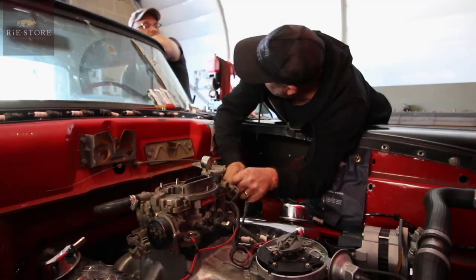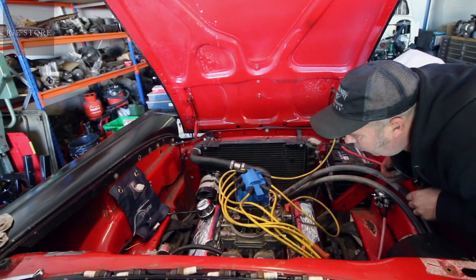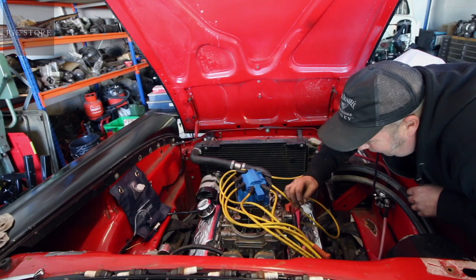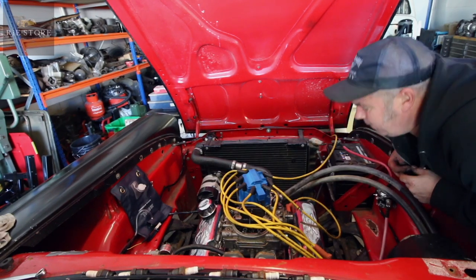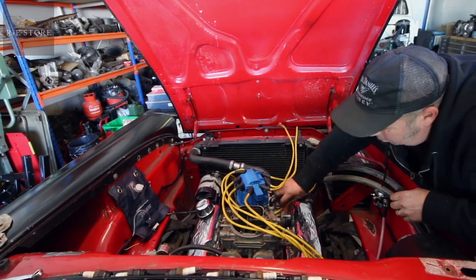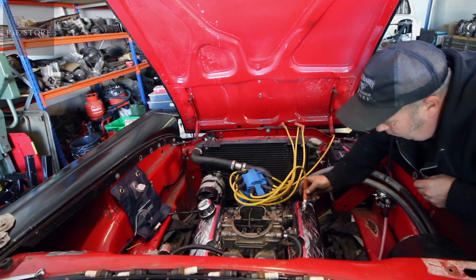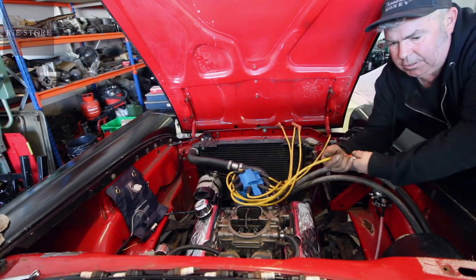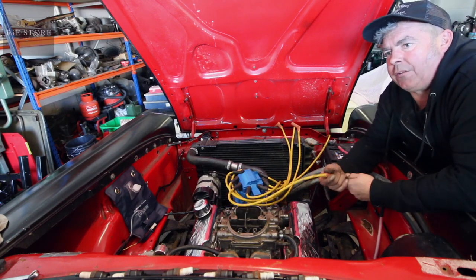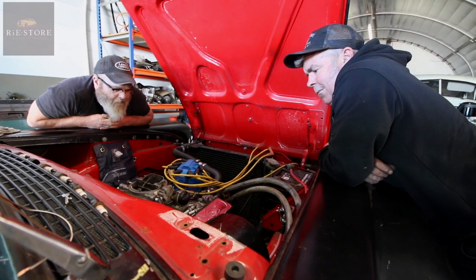You've got to have a set of Chevy headers, haven't you? Wouldn't say it's the strongest spark in the world. Not the biggest spark in the world. Let's try knocking a plug gap right down on one - knock it down to 25. Try that. There's no difference to the spark strength - it's obviously not the leads. Unless they're breaking down under load, but I doubt it. Let's see if I can find a points distributor for it.